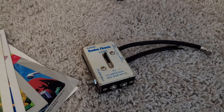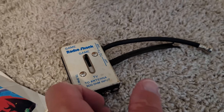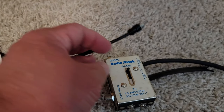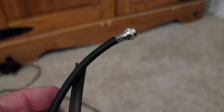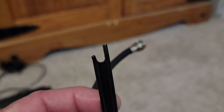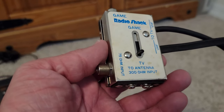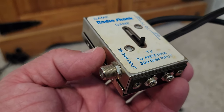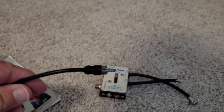Before we hook it up, I want to show this real quick. Dan included this Radio Shack game switch, which is so appropriate because I have my Tandy computer behind me. The way this works is that the game system hooks in right here with this particular cable, and then you hook this part into the coaxial cable input of your TV itself. That's the 75 ohm connection — there was also a 300 ohm for very old TVs. When you want to play your game, you switch to game; when you want TV, you switch back to TV.